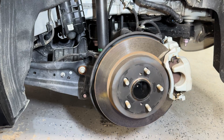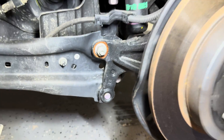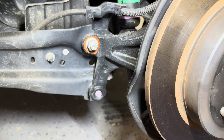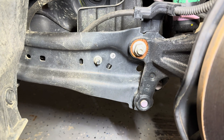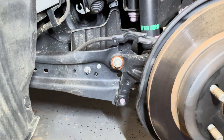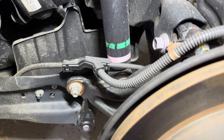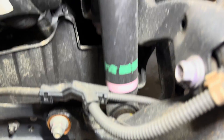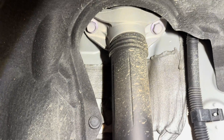Moving to the back of the Prius gives us an idea why the handling is so good, because it uses a multi-link setup. Getting in closer, we see the rear knuckle has two attachment points at the front, and instead of two individual links we have a big trailing arm that attaches to both points. At the front of it we can see where it attaches with a large bushing, which deals with a lot of forces and absorbs things like potholes and bumps. Directly behind that we see where the rear damper attaches to the knuckle and goes up toward the hatch area.